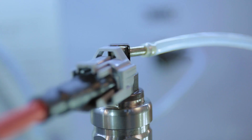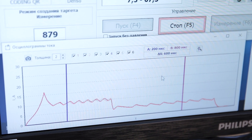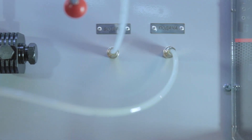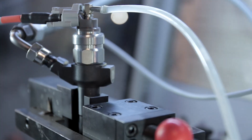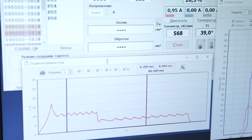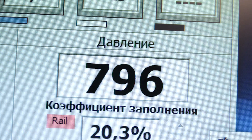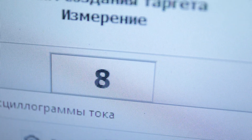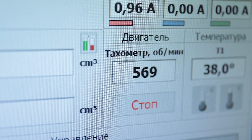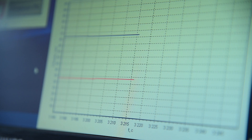The control system has a targeting function. A target is an internal test plan of the test bench tied to the individual fuel system configuration, used for precise correction code development. Delphi nozzles are tested and coded in a similar way, but it takes much longer due to a greater number of checkpoints. The measurement mode is on and dispensing is in process. We may turn on the nozzle controlling system oscillogram mode. It is also possible to create user's test plans with individual signal forms, demonstrating the diversity of program settings. In the coding process, in the delivery diagram, we can see the test bench adjusting the nozzle control pulse time to generate the correction code.